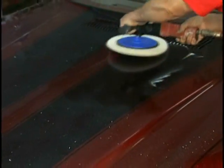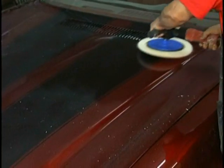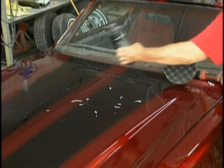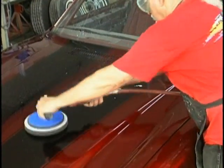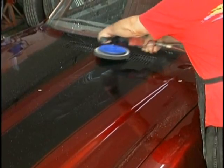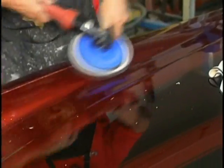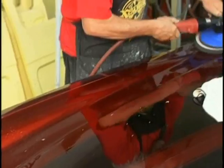The technology from Mirka also moves you from 2000 to 4000 grit. And 3M just came out with a Trizact system that moves to 3000 grit. This really helps bring that shine on fast. This particular clear buffs like butter, though. Here we are using a convoluted foam pad and using the machine glaze. This tells you just what kind of a job you've done, how well your polishing is going, because this will give you the look of the final shine. But look at our reflection in there. It comes back quick. It's so much fun at this stage to start seeing the results of the effort and the labor that we've put into this job.